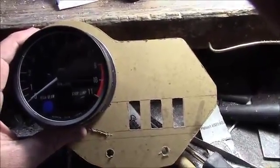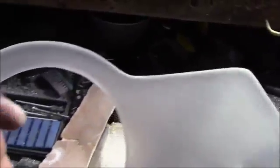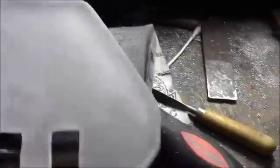I've got more finishing to do, and then I'll show you how the rest of it goes, and how it looks mounted. Okay, done with the pre-finishing. Sanding block, fine sand, medium. Make sure you get all the areas. I smoothed everything out so it was nice and round. Make sure you chamfer all holes really well and round out the outside portion, because there'll be stress fractures in plexiglass if you don't do that. I've run these for years and never had one break other than me breaking it. So now everything's pretty much smoothed up, all roughed up with fine. So now it's ready for paint.